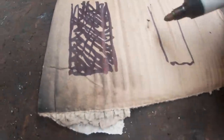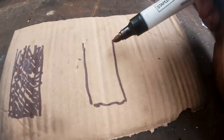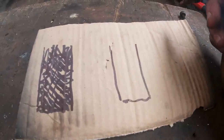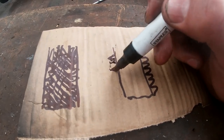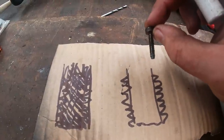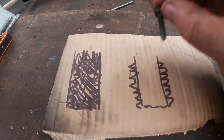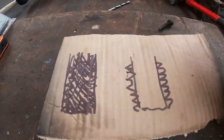And then what I can do, I'll just start on a new picture here. So I imagine that's this, but filled up. So what I then go ahead and do is drill all that stuff out. So obviously we're left with a nice clean hole again. However, you'll notice that there's no threads in there to screw a bolt into. So what I then go and do is tap that. And what that means, I've got to take a special tool and I'll just kind of slowly twist it in there. And then that goes ahead and produces a new hole for a bolt to screw into. Now I don't actually have the same size tap as this one, so I will be using a different bolt, but you know, the principle remains. I have a fresh hole with fresh threads and a bolt that fits. Did I say nut? I meant to say bolt. Yeah, so hopefully that explains that to anyone who didn't quite understand.